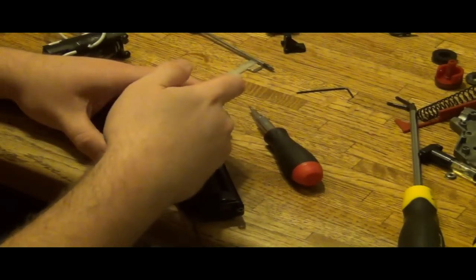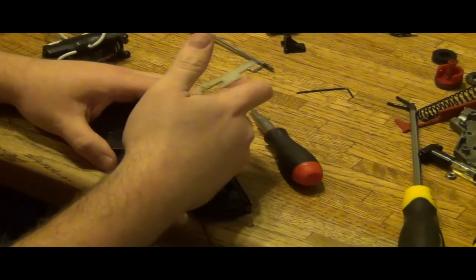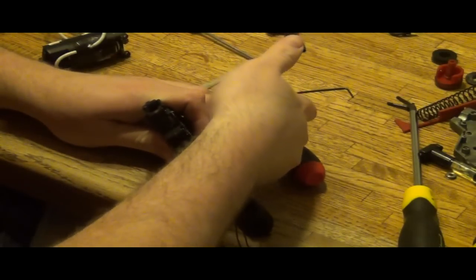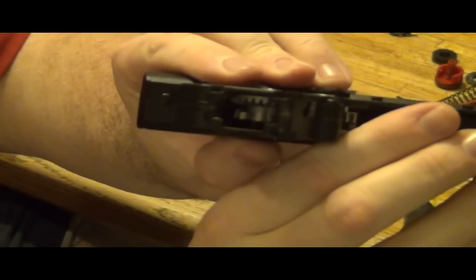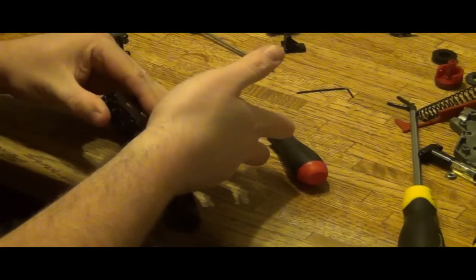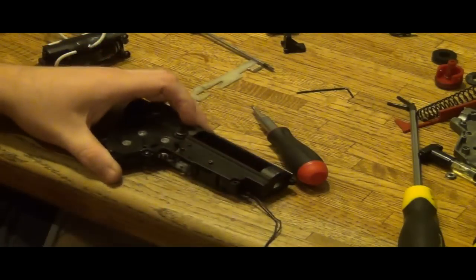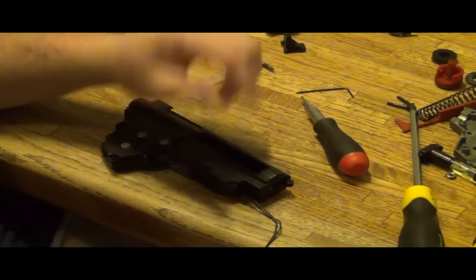Okay, so that goes really smooth, and it locks right away. Now while looking at it, oh, contact is beautiful. Just to show how beautiful it is, you can see how good that is. It's basically right at the bottom, still got 100% contact. It's not in the middle of the gear, but it's still 100% contact. And it applies just enough pressure to lock on the bevel gears.